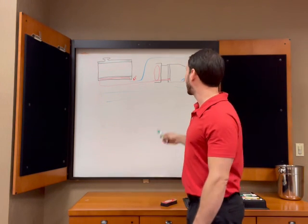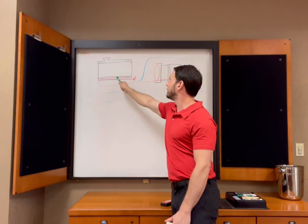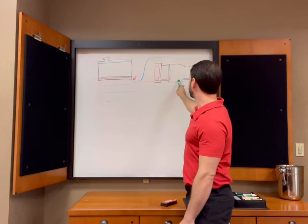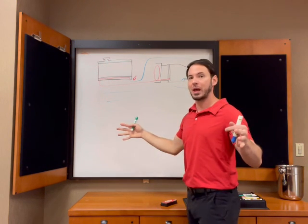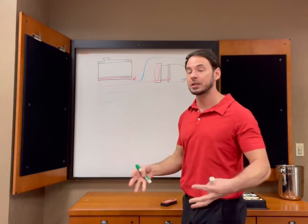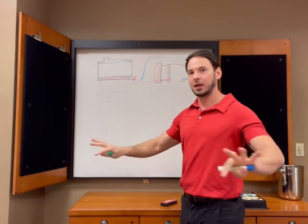Because as soon as I let off, if my fluid in here is 212, I'm probably at 250 coming out of here. And by the time it gets in here, that heat exchange is going to be really extreme. Not only that, I've got 212 degrees in this fluid pan, and 100 degree air out here, and a huge pan of inch-deep fluid. That heat is not going to stay in that fluid. You'd have to have something really generating a lot of heat to keep the fluid that hot. Remember, one of the main jobs of ATF is to absorb and dissipate heat.